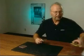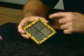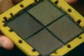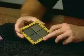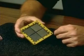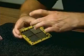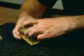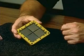Another key technology on the SV2 project is our compliant interconnect. We needed to achieve 3,800 connections between the multi-chip module and the printed circuit board. Each connection in the compliant interconnect requires about 40 grams of force to engage, which adds up to approximately 350 pounds of force to fully engage the multi-chip module down to the printed circuit board.